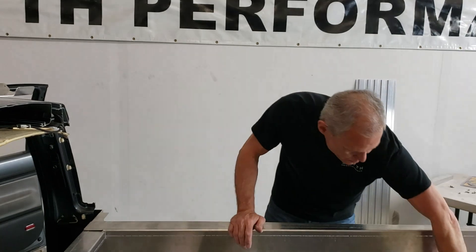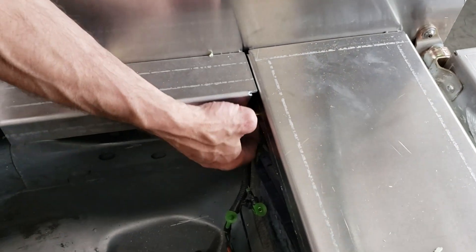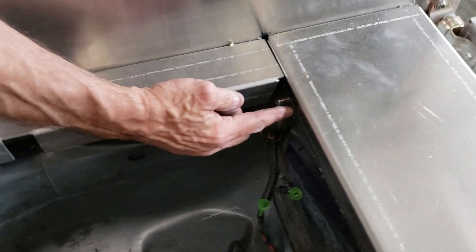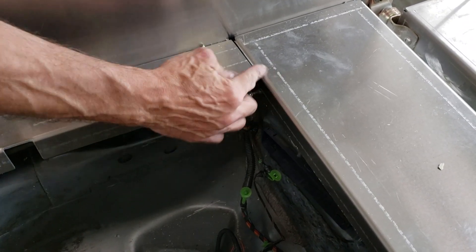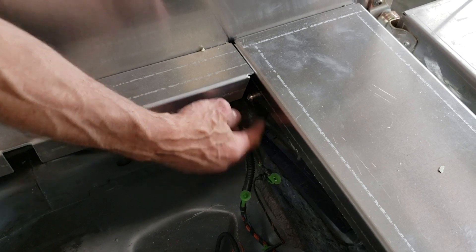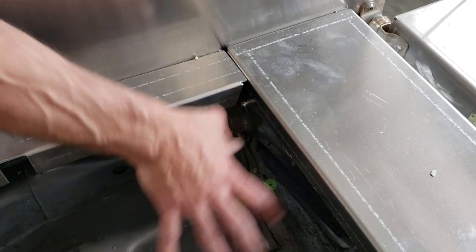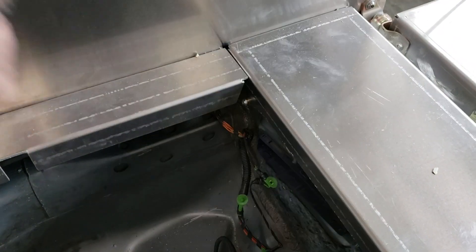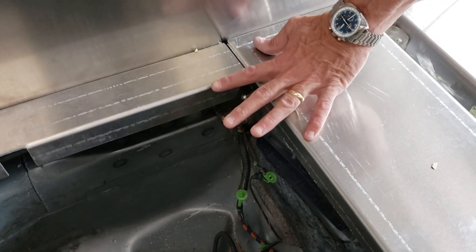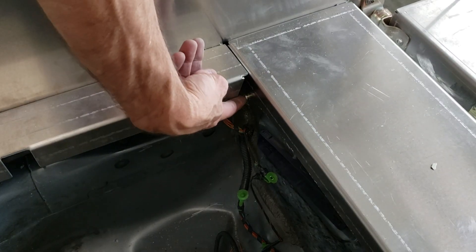One is this back corner. There are two holes on the bottom edge of the front tray. This little stainless fastener I have just put in place is threaded into the top bumper mount that's underneath here. There's actually a nut on the other side that's on the car — a threaded insert that's welded to the beetle. You're going to put one here and one on the other side, and that locks in the entire rear end of the car up and down and side to side. It's a very, very important bolt right here.